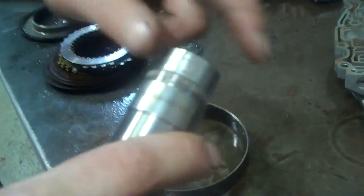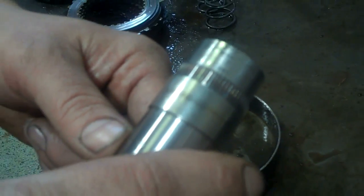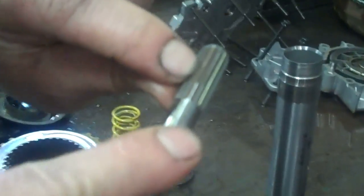This is what yours looks like — they're just smooth right here, there are no splines left. Here's a pump shaft; that's what drives your pump. Right here the splines are razor thin and they're about to strip out as well.